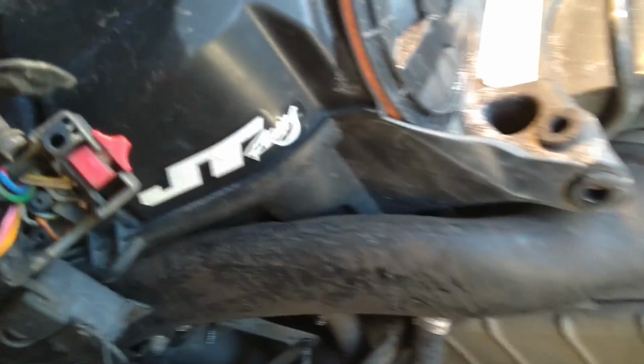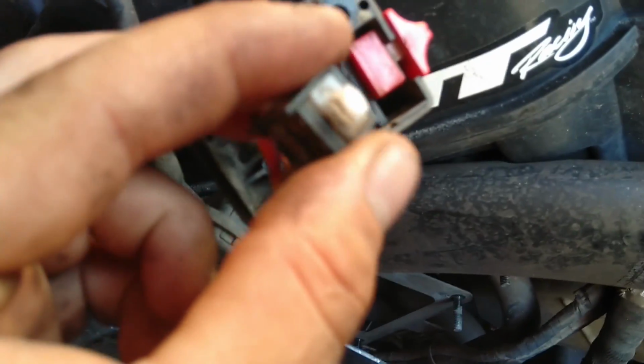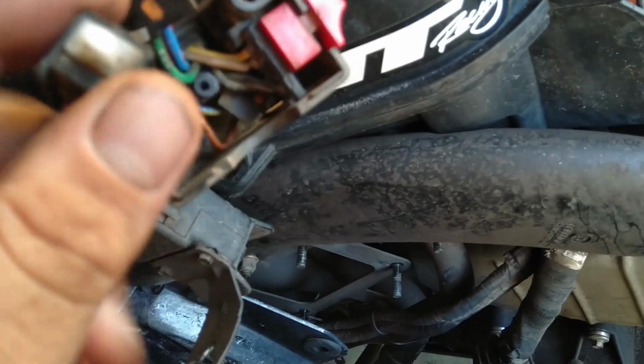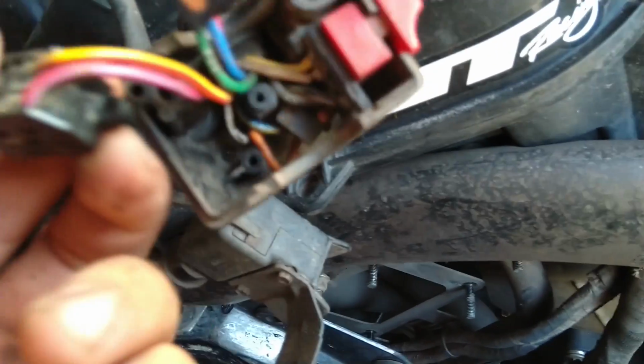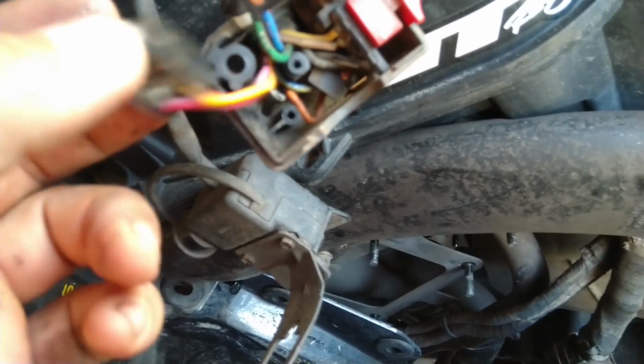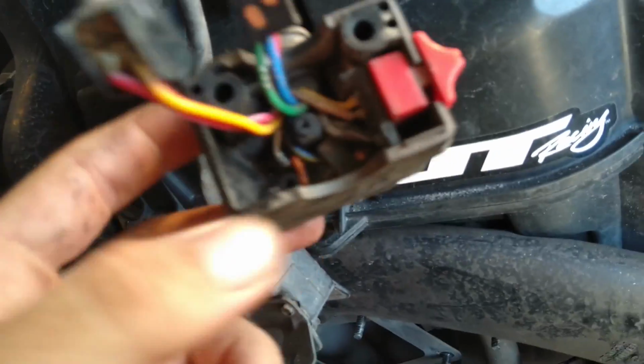All right, the crazy Can-Am electrical troubleshooting continues. So I figured out why it wasn't cranking yesterday initially. This is the start button. It was just corroded in there, and it wasn't making any connection when I put the ohm meter across it. So I cleaned that out and it seems to be working. Also my DPS button, that was full of corrosion too and water, and that's why I couldn't change my DPS modes yesterday.